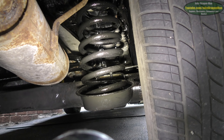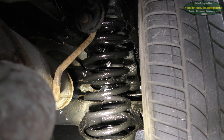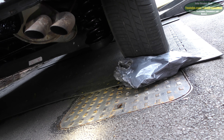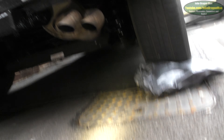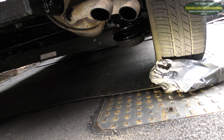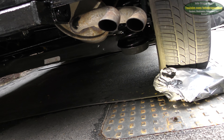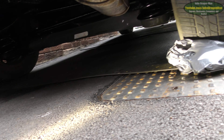I've got new brake pipe flexis in there as well, somewhere near the front — you can just see them through the coil springs. Brake pipe flexi, brand new, beautiful. That's on both sides as well. 11mm unions if ever you wanted to know — weird size. Well, they're like in between 10 and 11, because you put an 11mm brake pipe spanner on it and it's loose, but the 10mm won't fit. And it's not down to rust, because the unions on this thing are in really, really good condition. Someone very early on in this van's life actually greased all the brake pipes and the unions too, and there's no rust or corrosion — they're still bright and shiny, like the first day they came out of the factory. Really nice.